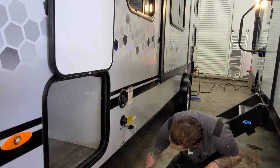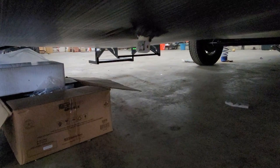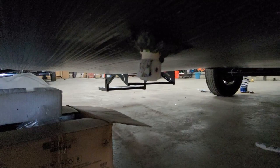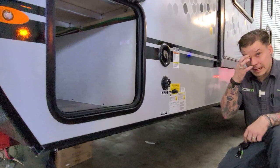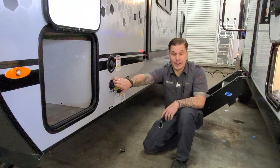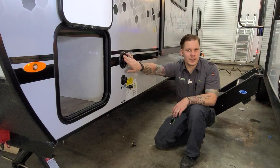If we take a look at the underside of the camper, we see a plug with a cap — that's how we drain the freshwater holding tank. Simply unscrew that and let the water gravity feed from the tank. The manufacturer recommends that anytime the unit is going to be in storage for more than seven days, you drain all the water from the unit. There is no need to drain that tank unless you have physically filled it up — it doesn't backfeed through the city water connection.